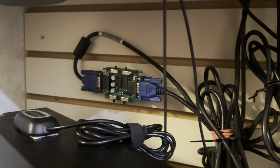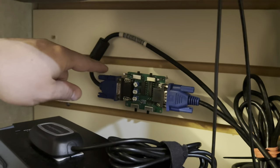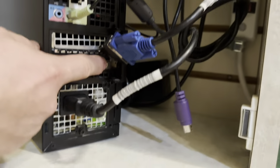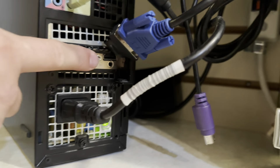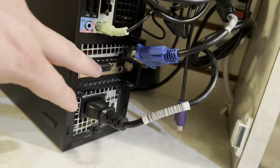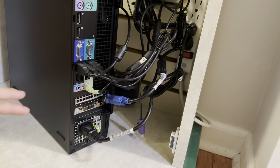Now I mentioned the Scanline Generator I'm using here, which I purchased on eBay for only eight bucks — this comes from China and it's the cheapest one you can get. It's pretty basic and you can only use VGA connections. The monitor is not an issue since it has VGA, but the issue is having a decent low-profile card that has a VGA connection. These low-profile cards usually have only HDMI and DVI. This one originally came with a VGA too, but you have to use the full-size bracket. So what I did is take the full-size bracket, use the adapter, and plug it right in. You can't use an HDMI-to-VGA or DVI-to-VGA adapter — it won't work with too many adapters and won't show the picture. That's how to resolve that issue if you want a powerful low-profile card.